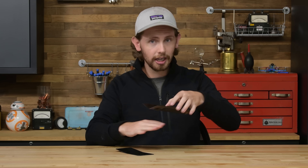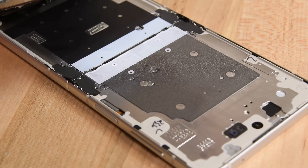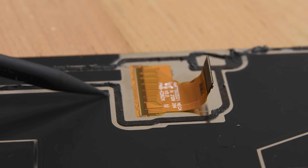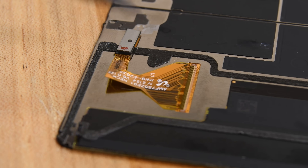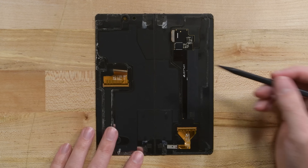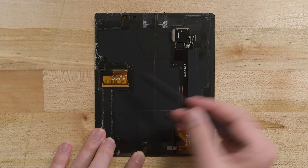Up to this point, both phones have been pretty similar to previous years, but I have a feeling that this is where things are going to get a little different. Samsung's strategy for water resistance is to allow water to get under the screen, but stop it before it gets anywhere important. Since we just submerged these for our intro shot, you'll see some water under this Z Flip display. On the back side of the Z Fold display, you can see the lines of residual adhesive. Samsung put adhesive perimeters all the way around each of the three cables, which is part of what made separating that screen so difficult. These glue trails have a purpose beyond general stickiness — the adhesive perimeters are strategically placed to protect each cable from water, which can and will get under the display.